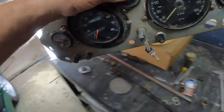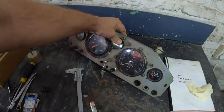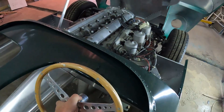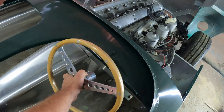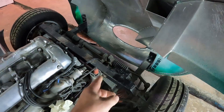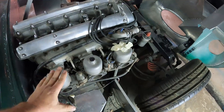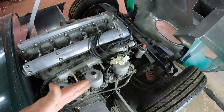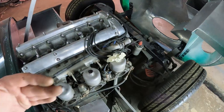The new dashboard needs to fit these dials nicely into the car. As far as the steering wheel is concerned, I need to find a route for the steering shaft — I've already made a mark where I want it to go — and it will go all the way down to where the rack and pinion is at the front. One issue I foresee is that the carburetors are probably going to be in the way, so I'll need to remove them, install the shaft, and then reconnect them without any interference.